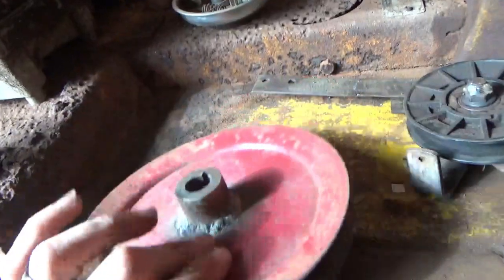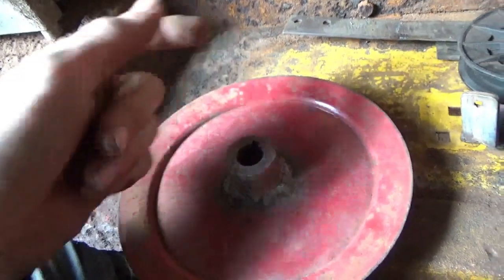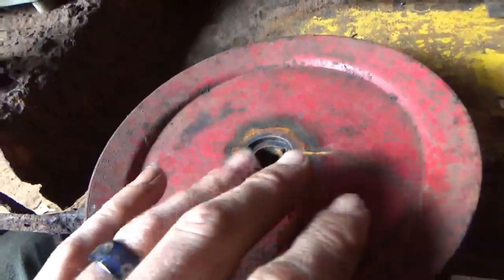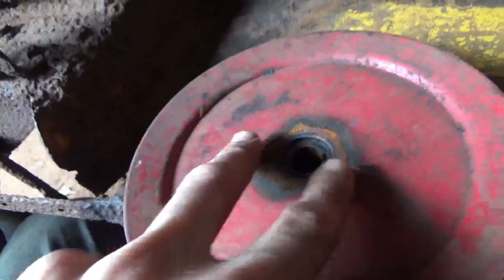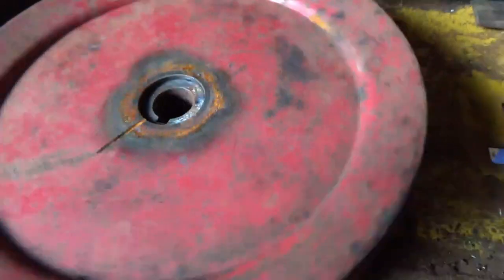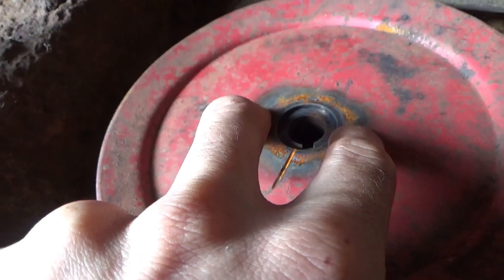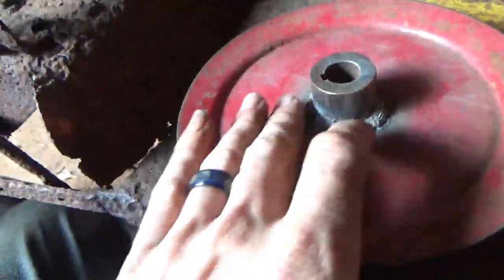The trans pulley was also rotted out, so I had to cut the center out of it — chopped it all the way down. Then I put it in the vice and grinded it all the way down all the way around. I took this pulley off of an old snapper deck that I have — had to cut the nut off, that's why you see a little gouge. It recessed right into the hole, I had to do just a little filing because there's a little raised part and the outer side drops down for the belt. I went ahead and drove that in and welded it all the way around.